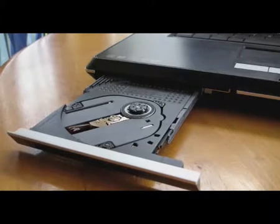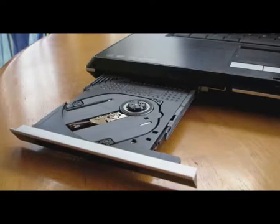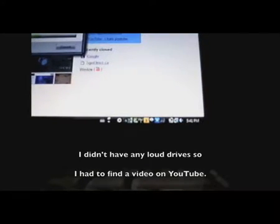CD and DVD drives. A CD or a DVD drive could go bad in a laptop and needs to be replaced. Some of the symptoms of a bad drive could be, number one, that it's loud. Now this could be when a disc is in or a disc is not in. Maybe there's a grinding sound. I've seen drives where when you put a disc in, maybe the spindle's loose or something's not grabbing, and it just kind of flings the CD around on the inside and makes a really loud noise that could scratch your CD.